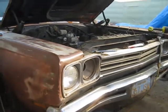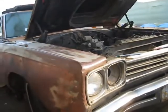But anyway, we're moving on with the motor. I'll make a distributor for it. Man, I haven't been selling distributors. I sell these adapters and stuff for making Hemi adapters. To take a 340, 318 small block Mopar distributor, and I make a shaft. You cut off your distributor shaft, and you slide this adapter on it, and it's got this pin to the right length and stuff. And then you bore a hole in it and drive a pin in it, and you're done. They run straight and true, and you can just buy a cheap late model distributor, for $100 or something, or $70 or whatever you can find them for.